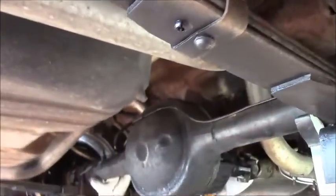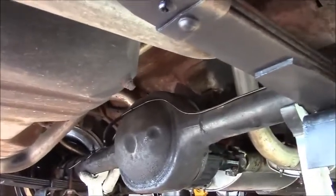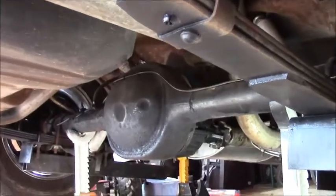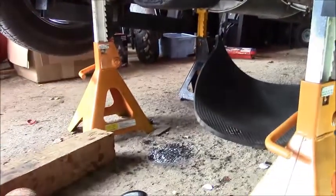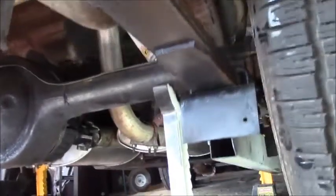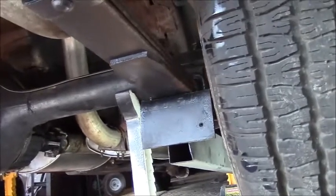Okay, so I got all the oil in the pumpkin. I call it the pumpkin. We always called it the pumpkin when I was a kid. In the rear end gear housing. Made sure it was nice and full. Oil was running back out. Got those U-joints greased, which I thought I heard the front one squeaking, and they took quite a bit of grease, so they should be okay now.